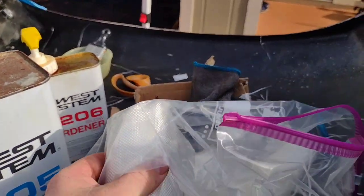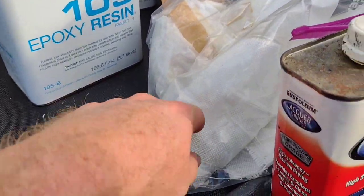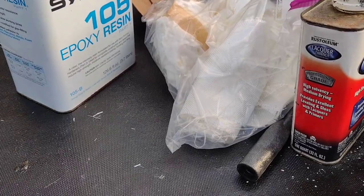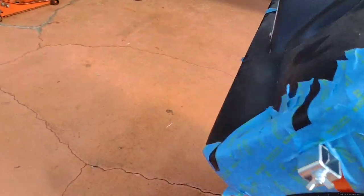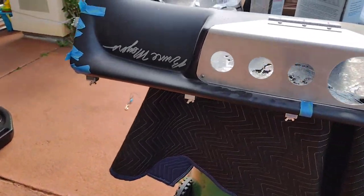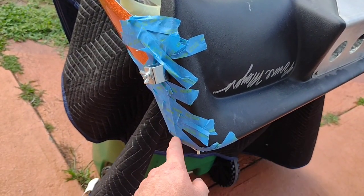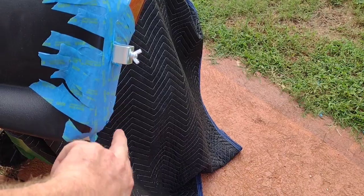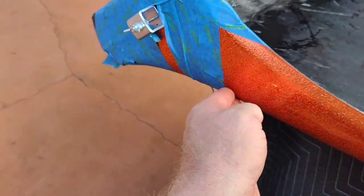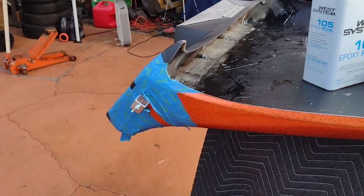I also used fiberglass I bought on Amazon — not the mesh mat but the woven stuff. It was a little thick; I'd say go a little lighter so you can get the resin all the way through it. It fit pretty well. I've heard about some not fitting correctly, up to a quarter inch on the sides, but this one fit well. That seems to be an issue on the early bodies, not on the new classic Manx body like this one. Anyway, get out there and get your projects done — don't forget to like and subscribe.